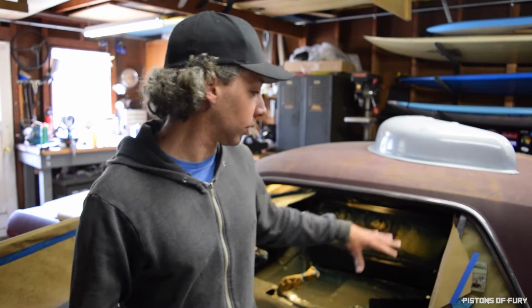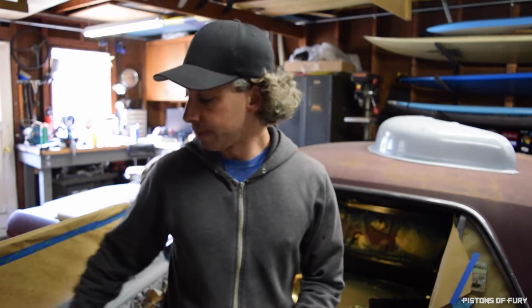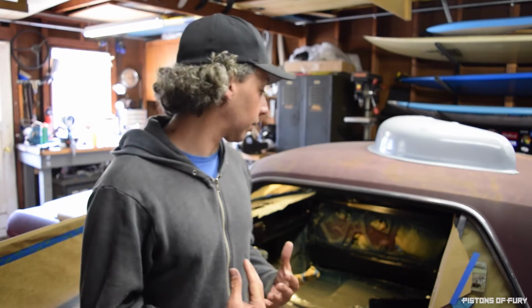And that's especially important on pieces like these rear quarter trim panels and the doors that have this texture, because I can't sand those. So I need to make sure that I get everything coated within this 24-hour period. So I need to get set up again, and we're going to go in here and spray.